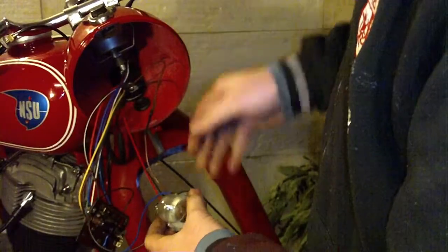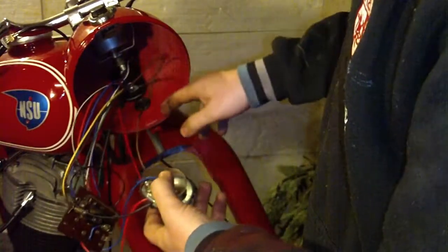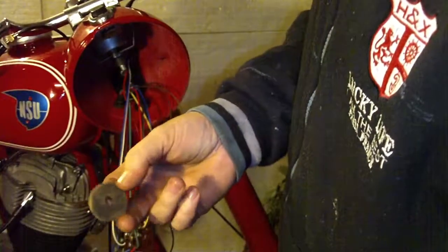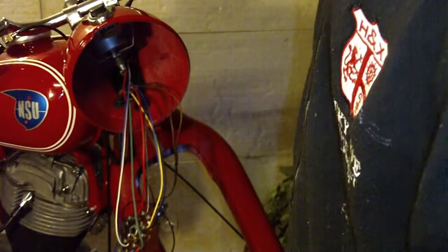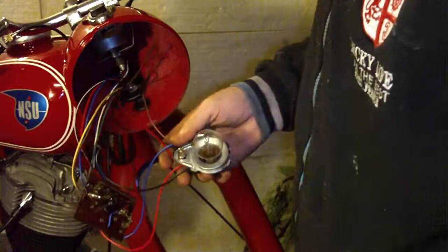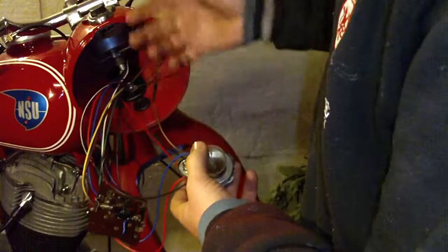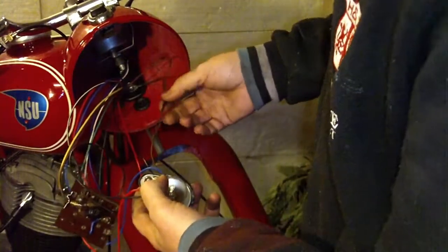And also the battery box is connected similar like this. It has these shock absorbing rubbers, and it is also isolated from the main frame, so there is a big chance that you will not have a good contact if you connect the wires immediately onto the battery box.